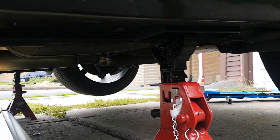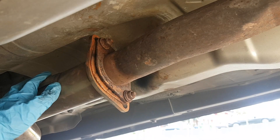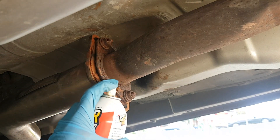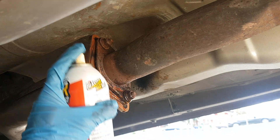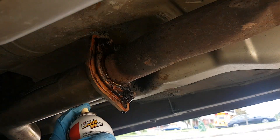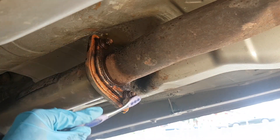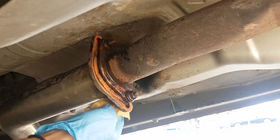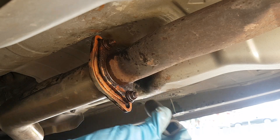Next, go from the side of the car and get under here. I previously deleted my cat from a different downpipe — these look rusty, so take your PB Blaster, squirt there and up there. Agitate the surface a little bit; you should also use sandpaper if the surface is rusted. You're gonna need a 14 millimeter.